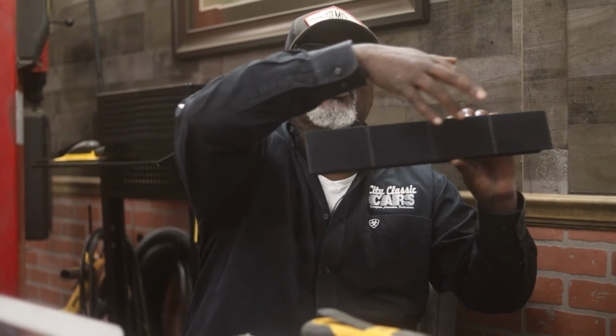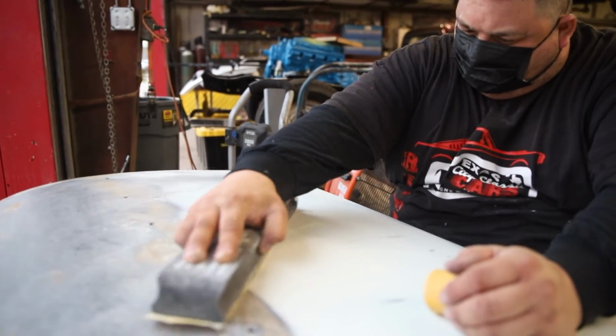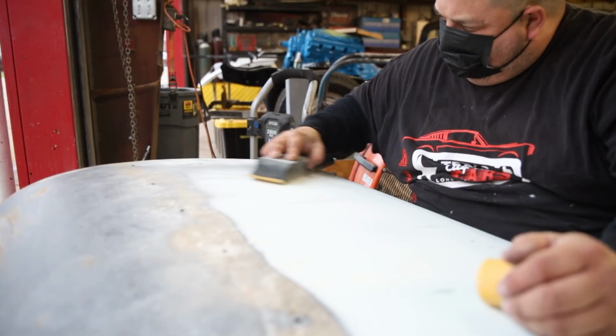The second thing is you're looking for black, or red, whatever your contrast color is to your primer. If you guide coated it in black and you see black, that means it's a low spot. Because if it's all flat, paint wouldn't be gone here and gone here and gone here. If there's still some paint here and here and here, those spots were too low for you to get to. And that's what that means. If you sand and you see that it's all the color of your primer, and whatever contrast color you used is no longer there, that means you're finished blocking in that area. No need to do it again, it's done.